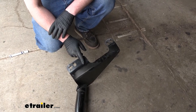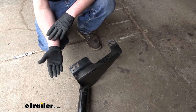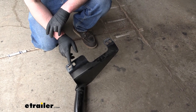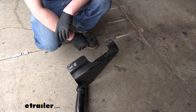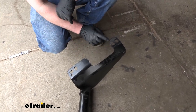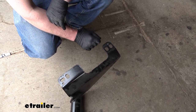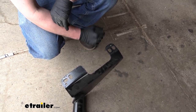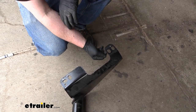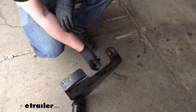Before we put our hitch up, I just wanted to go over something real quick. On the passenger side, there's only three openings — straightforward in terms of where the bolts are going to come through. On the driver's side though, there's several different ones and you're going to be using this one here. Depending on what you have in terms of this attachment point towards the front of our vehicle — if you have a standard gas engine like we do, you're going to be using this one; if you have a hybrid, you're going to use this one. So just wanted to point that out.